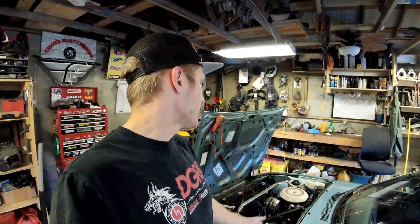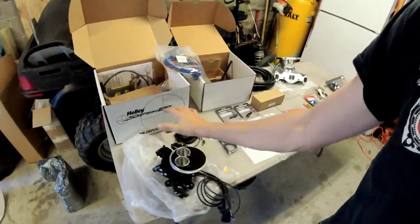A stock 12A is a 1.1-liter engine — it does not require a ton of air, and this engine is not ported. The stock Nikki carburetor is around 370–400 CFM, so the two-barrel is going to work perfectly fine. The big four-barrel unit will essentially be the same install process as outlined here; you just won't have the two-barrel portion of the situation.